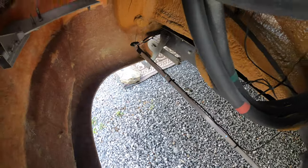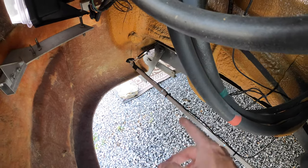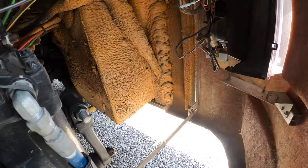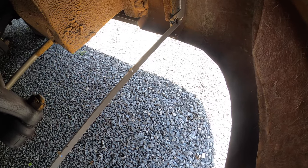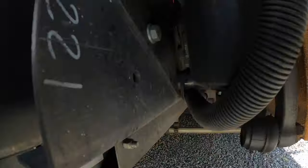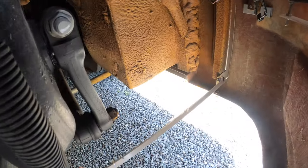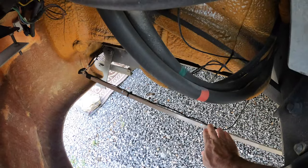And then immediately after, at about the same time, the wiring melted and caught fire. I came up front. I got this from Lowe's — this half-inch aluminum channel — for eleven dollars for an eight-foot piece. What he had done was run a piece of plastic lower down, drilled a tiny screw hole in the fiberglass on both sides, and within 50 miles the screw pulled out and broke the cheap plastic on both sides. So I reinstalled it myself with this aluminum frame — it's screwed solid to the bottom of the generator bracket. I zip-tied it for extra security. It ain't moving.